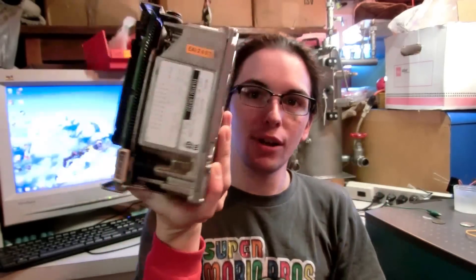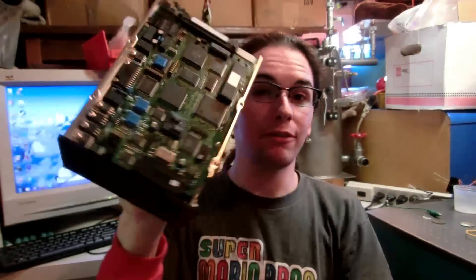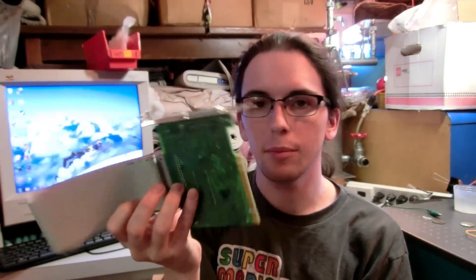This is a large, full-height hard drive. It cost me about $15 from Weird Stuff Warehouse, uses a SCSI adapter, so it's probably from after 1986, and it runs off a regular 12-volt and 5-volt Molex connector. We can hook this into a modern computer with the help of an adapter card, which only cost me about $3. Let's grab a computer from my landlord's garage, install Ubuntu on it, and test these out.